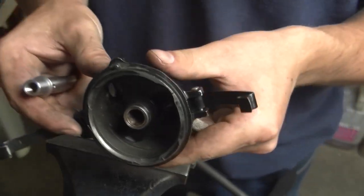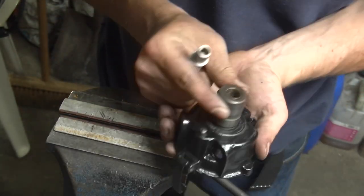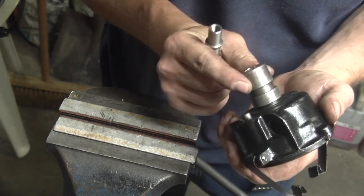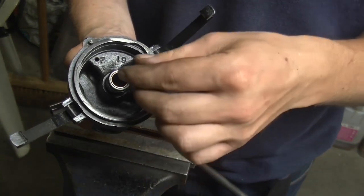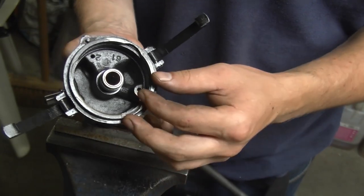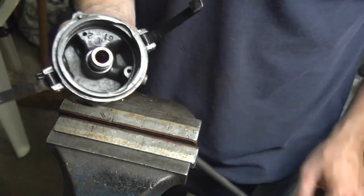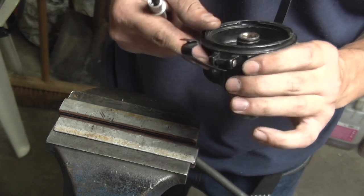We got that sorted, and what I can see on the inside is that the bushings have a fully clean pattern in it. Meaning that the entire surface has been reamed, that I don't have any spots in there that have not been reamed. So once it wears, it's going to push down that direction. Now it's nice and clean, so we have a full bearing surface.